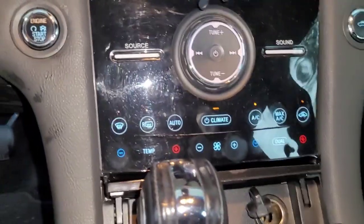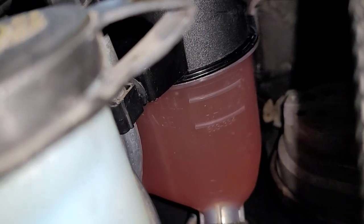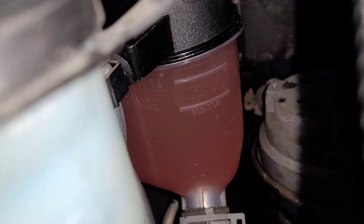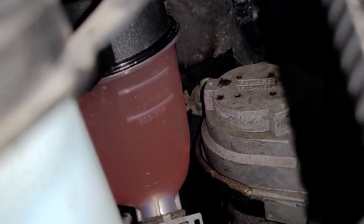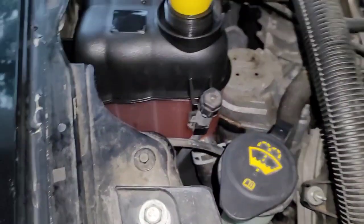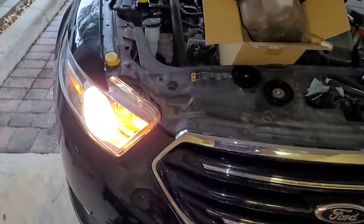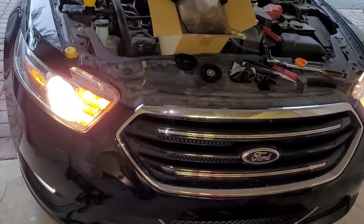To properly burp the system, turn the heat on high like that and go check the coolant reservoir up front. Make sure the coolant level goes down as expected — it is going down a little bit, which is normal. I actually overfilled it slightly, so I'll take a little out. Let the cooling system take on the coolant and make sure the vehicle runs fine. That should be the end of the video — if you found this helpful, please drop a like, subscribe, comment down below, and I'll see you in the next one.